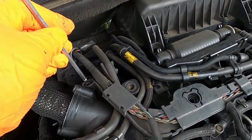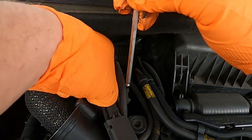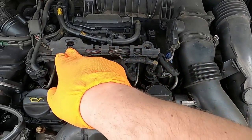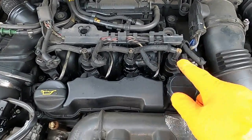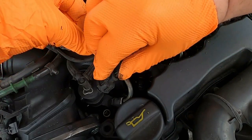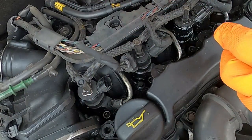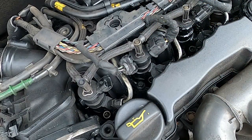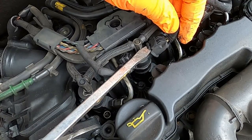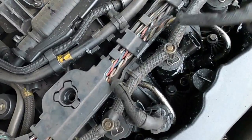And one more — it's a little hidden one in here. Once your hex bolts have been removed, we're going to disconnect the injectors. You just press the clip and push it towards yourself. For some of them I'm going to need a flat screwdriver to lift the thing up and push the connector off. Same thing here — the connector pushes off.